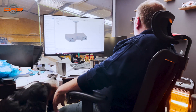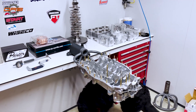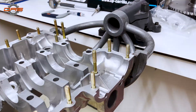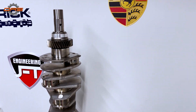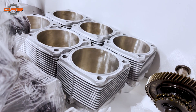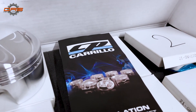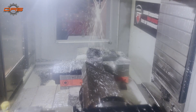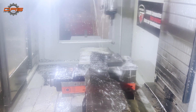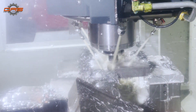We've had a lot of issues this day preparing the crankshaft. You have to take off the old gears and put them back on the new GT3 crank. Today we discovered we had way too many issues than normally, and Philip designed a special tool to align the crankshaft with the gears and press them off and on much easier. This is one of the many benefits of working with JFT engineering and having a big CNC machine. Everything that poses as a problem can be fixed right away — the tool is made within hours of the original design, and here are some nice shots of the part being machined.